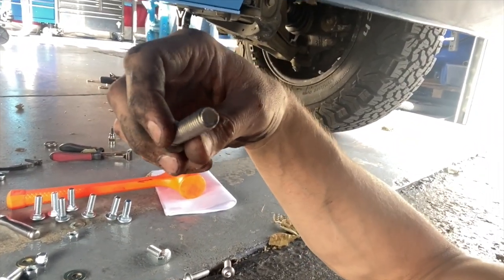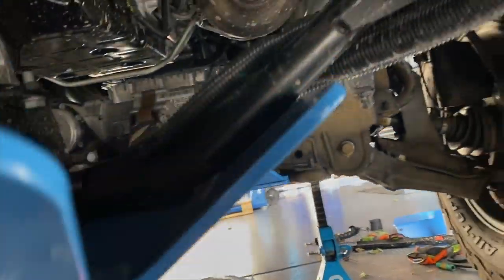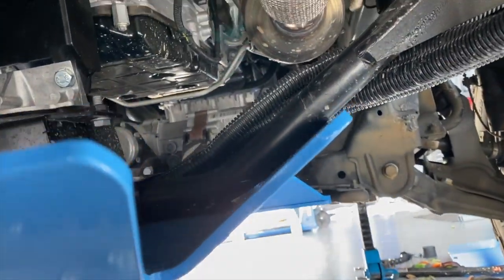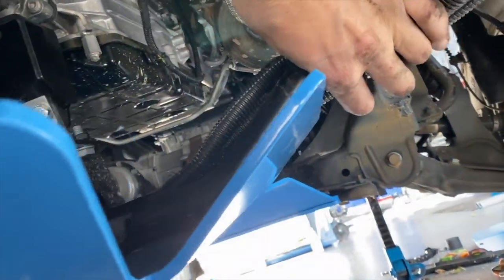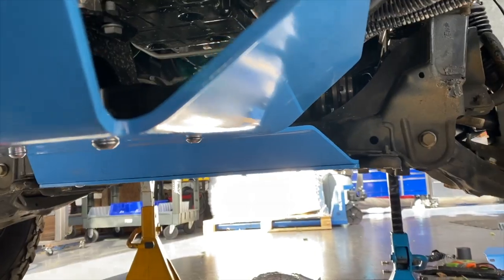Now what we've got to do is take these brackets and put them over the top of where all those wires are, then take these allen head bolts and nuts and run those up and tighten them down. This is why — especially if you have a Revel — getting the transmission transfer case skid plate in addition to the engine skid plate is so beneficial. Look at how previously all of these cables hung really low on the vehicle and would have been the first thing to contact any sort of off-road rock, log, etc. Now they're all tucked up. You've got these side wings that push all the wires — they're still loose enough that you're not pinching them but everything is held nice and tight and tidy, and you've got a lot of protection.